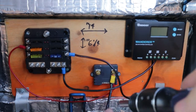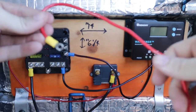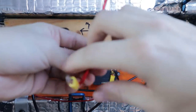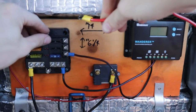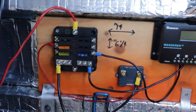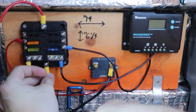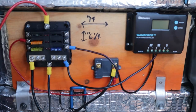Take your ground from your battery monitor to the ground of your fuse block, which will be grounded to your truck. Now take the positive wire that's gonna go to our battery and hook that to the positive top notch of your fuse panel — that is the source — and tighten that down. Next up is the ground that will connect to the bottom of the fuse panel, which will go to the ground of your truck.